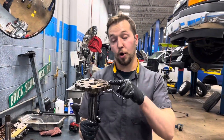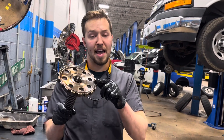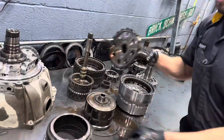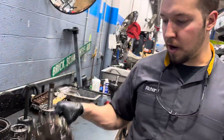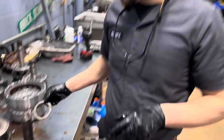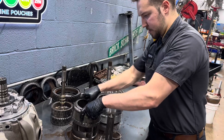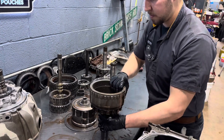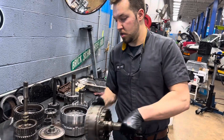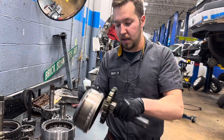Normally when you have this it will throw codes — in a four-wheel-drive truck I've never seen this on a two-wheel-drive truck or van, and I've never seen it not have codes. Normally you will have codes for output speed sensor or transfer case correlation, but on a two-wheel drive, apparently not. The bearing out back looks okay. When this is sitting in the trans, it's not going to want to spline right now. When this is just spinning, this entire piece gets galled up because this output gear set assembly is trying to spin. With this broken and just sitting there spinning, it galls this up.